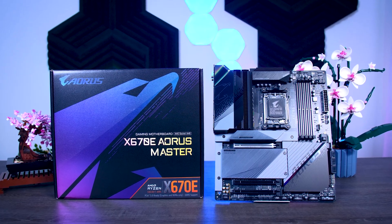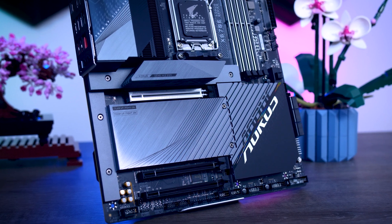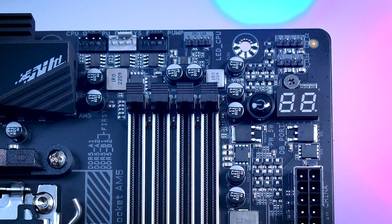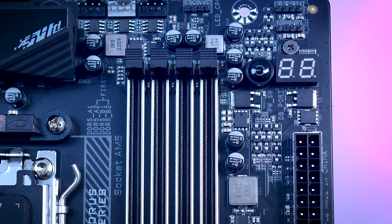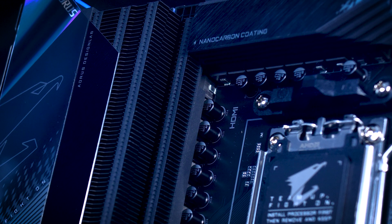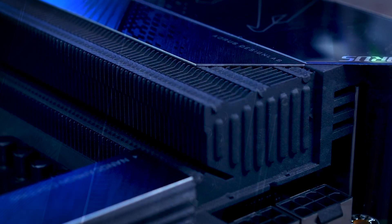The X670E Aorus Master is a really big step up, launching at around $500. The Master instantly feels very high-end with a stunning design — a lot of metal covering the front of the board and a full metal backplate, which you don't even get on a $700 ASUS HERO board. You also get a postcode and proper buttons, so this should be a very good board to play with. Note that this is an extended ATX board, so it is wider than a typical ATX one and you'll need to make sure it fits your case. Power delivery gets an upgrade too: 16 105-amp power stages just for the CPU, plus four more for the memory and SoC. Gigabyte put a proper finned heatsink on top of the VRM, so even a 7900X or 7950X with a serious overclock will be just fine.